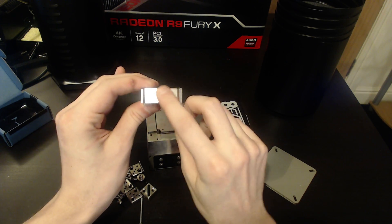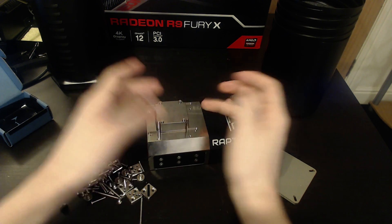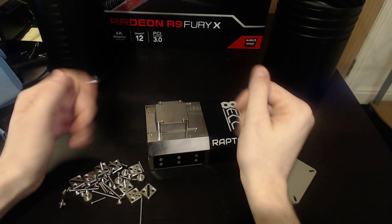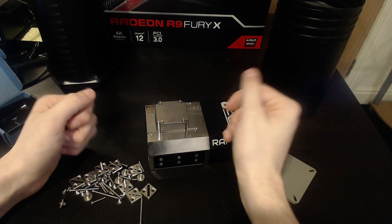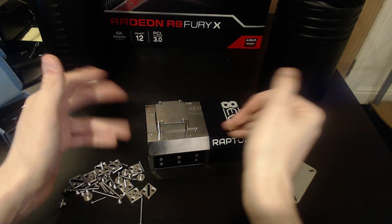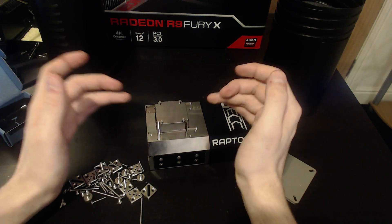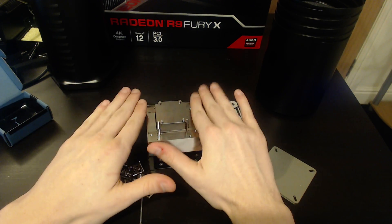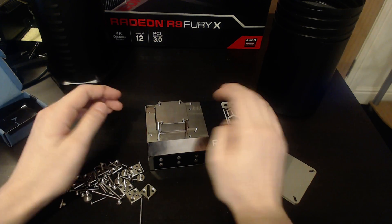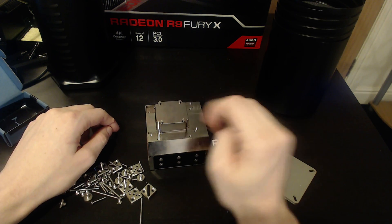It has a little hole for your thermocouple, and it basically extends the base of the pot. It has four Torx screws. Why would you want to use this? Well, it gives you better insulation, because you can get ArmaFlex all the way up to basically here, which means you have much less water buildup directly on the GPU's PCB. It also means it's possible to use all kinds of aluminum heat sinks and stuff that might be extending the height of the PCB significantly, so this doesn't conflict with anything that's tall on the PCB, giving you a lot more compatibility.